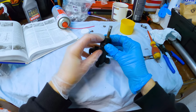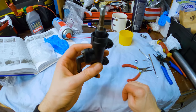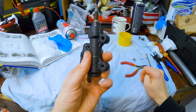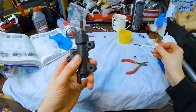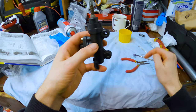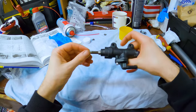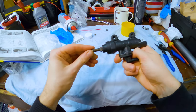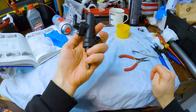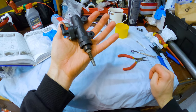Problem with this is once you've taken it apart I can't remember how it looked originally. Right, I've got it on now — there's like a little groove that it kind of locates into and it's the same all the way around. I just had to use a screwdriver gently and go around the edge, just nudge it down until it sits flat. The seal's obviously just stopping crap going back up inside, so that's working as you would expect. That's it — that's another first for me, first time I've rebuilt a rear master cylinder. Much easier than doing the front one, that's for sure.